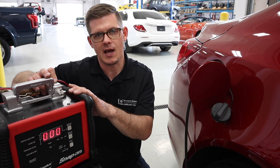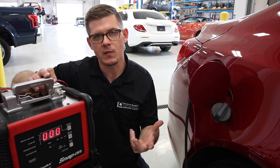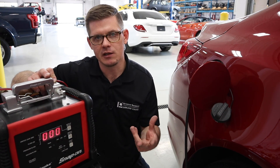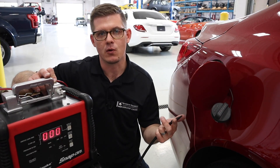The great thing about this tool is that the smoke is a great visual indicator to see what's happening. Just remember to use your scan tool to close and seal the system, and verify first that your tool is working and emitting smoke.